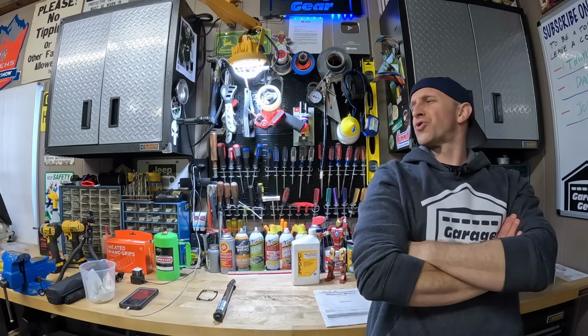Now, how often should you check the gearbox on this Cub Cadet 3X? Well, I typically recommend checking the gearbox at least once a season, but given the need for a new gasket and the expensive Cub Cadet oil, if you're keeping an eye on it and you're not seeing any leaks and you're not using the unit commercially, you could possibly check it every other year to make sure that everything's in proper working order. Well, what does the manual say?